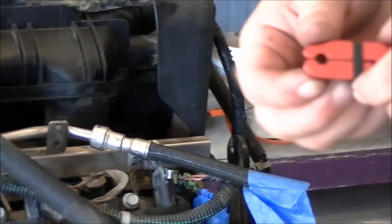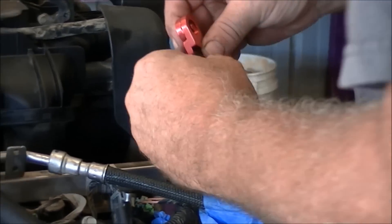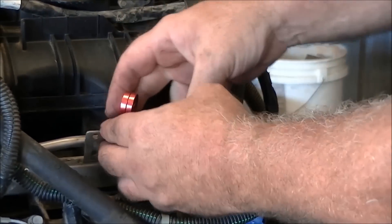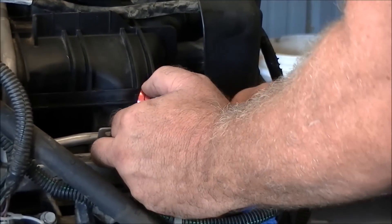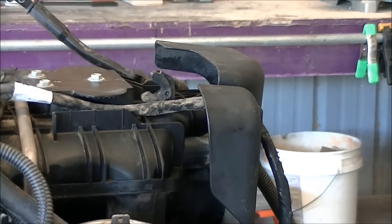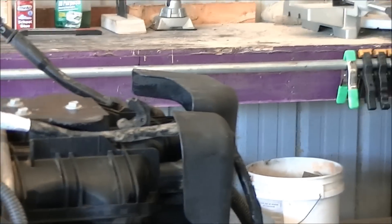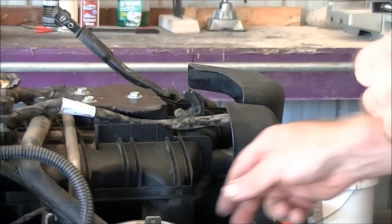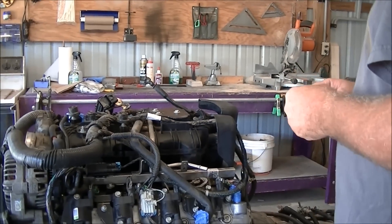Using the same 5/16" fuel disconnect tool that we used on the truck, we're going to go ahead and get this connector apart. This is the hose that was cut off by the salvage yard. We're going to retain this because we're probably going to have to use a custom fuel line from the hose shop. I want to be able to take that with me once I get my measurement and hand it to them so they can give me the right connector for my vehicle.